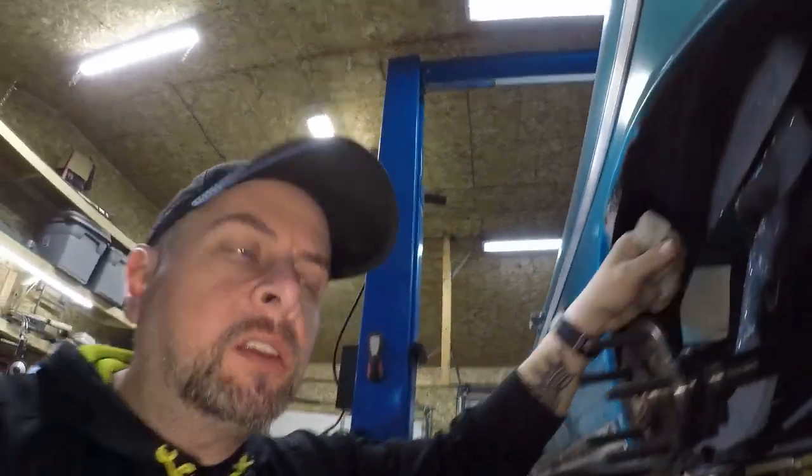Alright, now that I've got that switched over, I want to show you this rear end had disc brakes on it in the past. So it's already had a conversion once, but the previous owner kept the kit. Some of the things that normally you would have to do on a Dana 60 or Chrysler 8 3/4 have already been done. One of those is to remove the old style bearings and install what they call the green bearings if you don't already have them. Those are bearings that have a circlip retainer in them. You'll also put in a spacer, which essentially takes up the room that your backing plate from your drum brakes used. So I'll show you that.